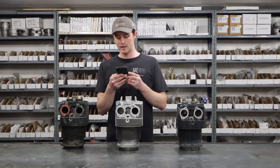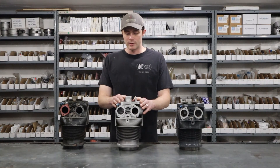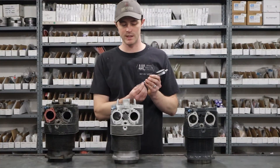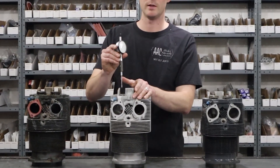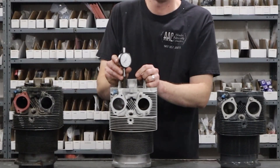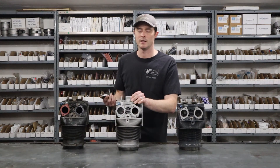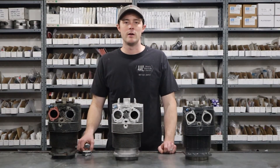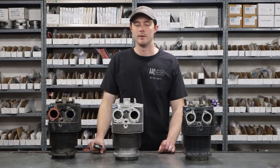Espinoza asks: how can you replace the valve guide and how can you measure the inside diameter of valve guides? On measuring — let me grab a comparator here. We put different tips on this for different size valve guides, and then we set this to the dimension of the valve. As we put this down into the valve guide, that gauge is going to read how many thousandths bigger the guide is than the valve. Depending on the cylinder we're looking for a different number, but that's how we look to see if we're within limits or if it's worn out. Commonly on an exhaust valve guide, the valve guide should be about four to six thousandths. Using our comparator, if we find that the valve guide is worn out to 10, 15, even 20 thousandths when it's real bad, that's certainly when we need to replace the valve guide.